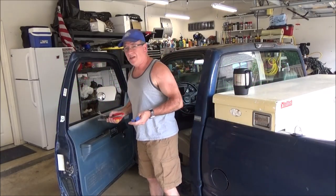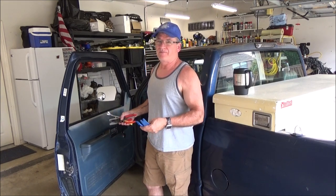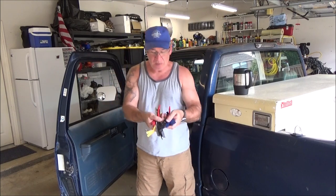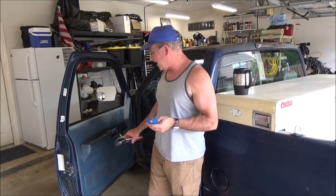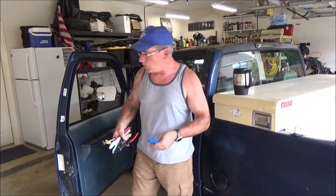I'm not going to do a whole in-depth thing on removing the door panel — I'm just going to do a quickie with some nice music, because there's hundreds of videos on removing a door panel in an OBS truck. But I will say: use the right tools. All these panel tools are really, really cheap — you can get them on eBay or Amazon. Use the right tools so you don't damage your doors. I've already taken this off before to fix something, and all the clips are broken because somebody used the wrong tools. So use the right tools.